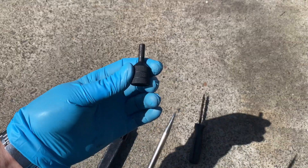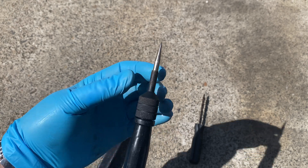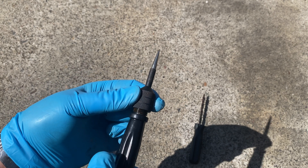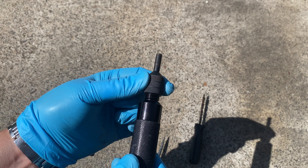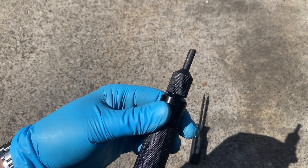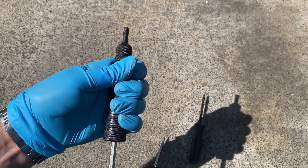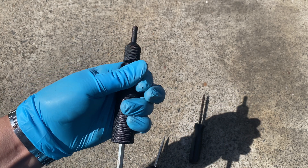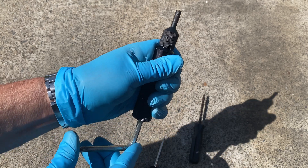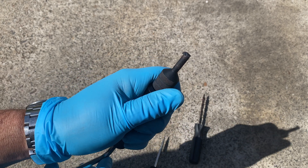Excellent. At this point on the tire we've already reamed it out, and we would put this applicator tip right here on the probe. So we would jam it into the tire and then this would be sticking out of the tire. We will unscrew this and attach this handle with the mushroom tip into this applicator — I'm showing you what it looks like off the tire first so you understand the concept. We're going to twist and twist and twist. What this is going to do is actually compress the little mushroom tip, and as we're twisting it's going to force the plug through the tip — and you see it's starting to come through.